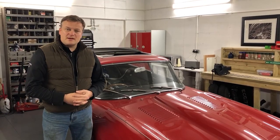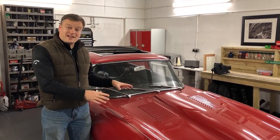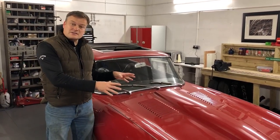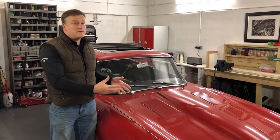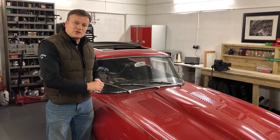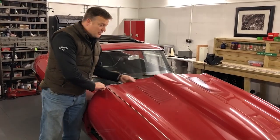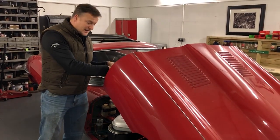In this episode I'm going to look at one of the things that helps the E-Type stand apart. Back in 1961 the car was claimed to do 150mph, which was particularly fast for its time. One of the reasons it did that is it's got this great engine under the bonnet. This is a later car, so instead of having the 3.8 it's got the 4.2 litre straight-six engine. In this episode I'm going to focus on the SU carburetors. In comparison to most cars of the time which had one, possibly two carburetors, the E-Type's got three and they're the biggest SU carburetors that you can get.